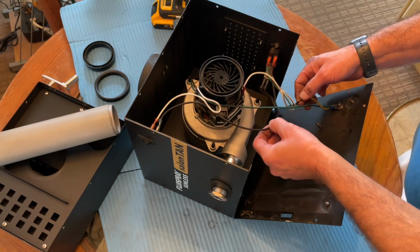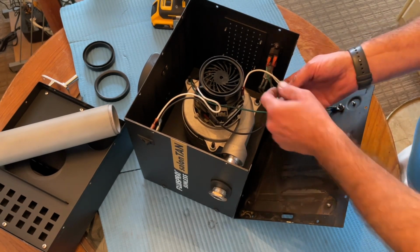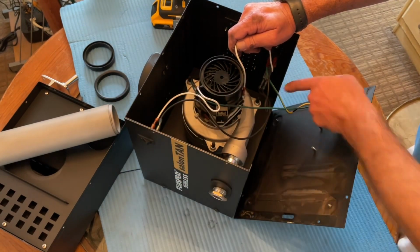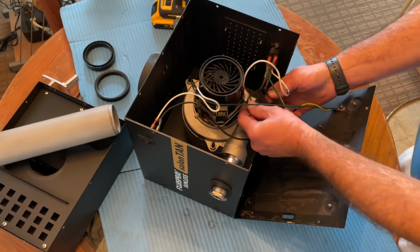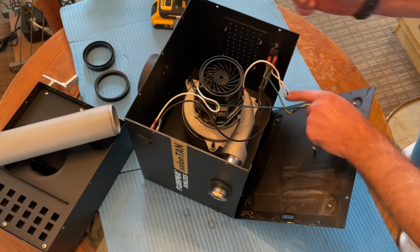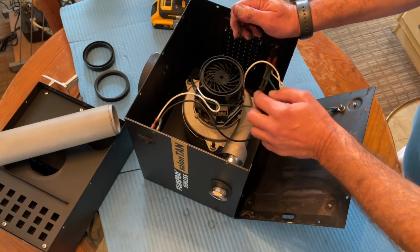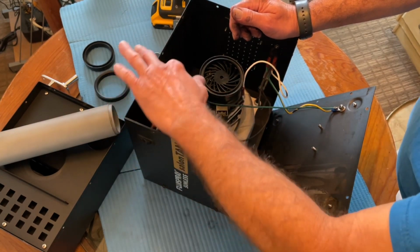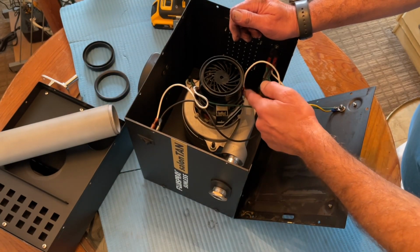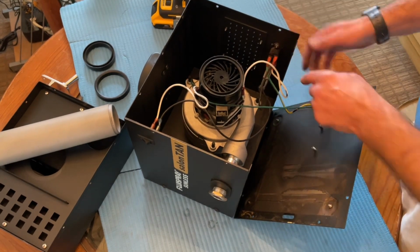Okay. Yeah, a lot of residue in here. Sticky tanning solution. Okay, so now I can spread my wires out. I see that the long black wire goes from the switch to the fuse. Short one goes from the fuse to the cord connector. There's a ground to the cord connector, ground to the motor, and then one neutral goes to the switch, the neutral closest to the switch from the motor, and the other neutral that will be attached to the motor when you get the replacement motor goes to the cable connect.